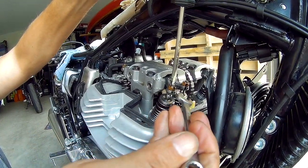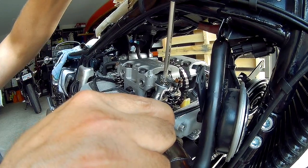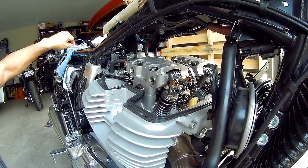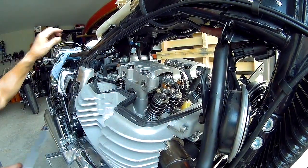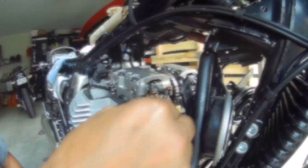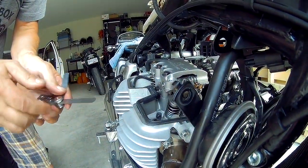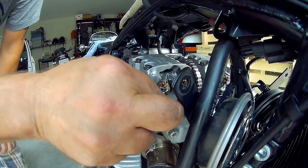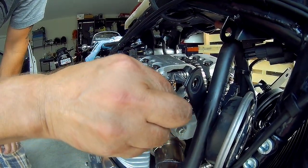It's just a go-by sort of feel with the feeler gauge. I think if you stay consistent with your valve adjustment, then you should be good. So yeah, I'm going to rotate the engine once more and then we'll check it again. Good. Be careful as well when you're measuring, because if you twist the feeler gauge just a bit, you'll get more resistance than you probably want. So make sure it's level with the face of the tappets.